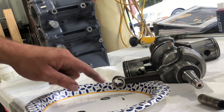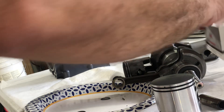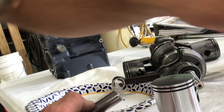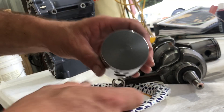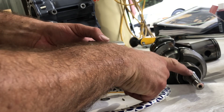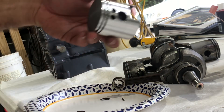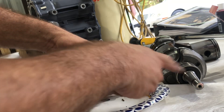What I'm going to do is reinstall with a new piston — a new wrist pin replaces the old one. There is a certain way these pistons go; it usually says 'up' on top of them. When they say 'up,' that means this piston will face the tapered end of the crankshaft, and your wrist pin will go in like this. So this side marked 'up' is going to face toward the tapered end of the crankshaft.